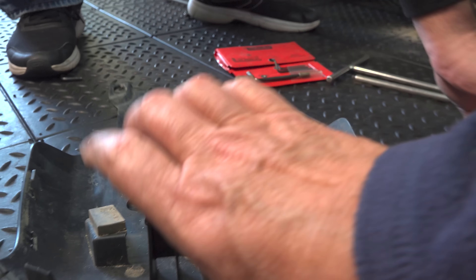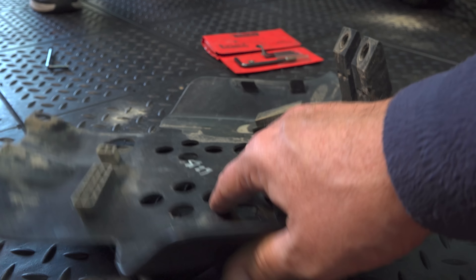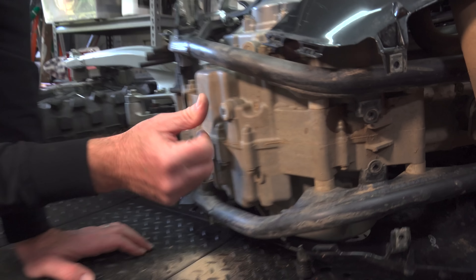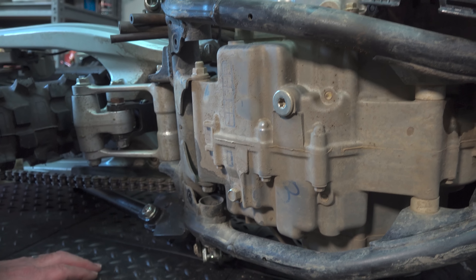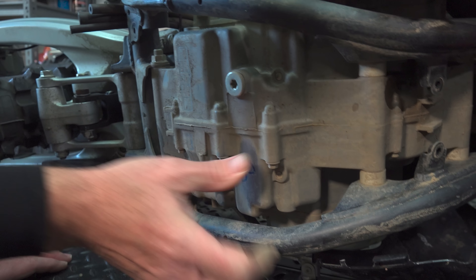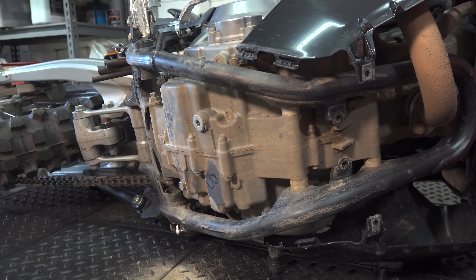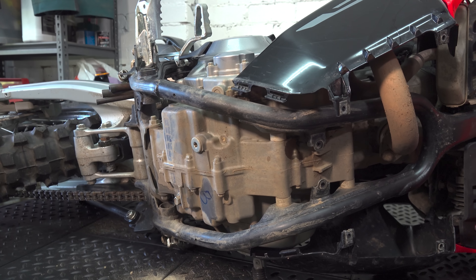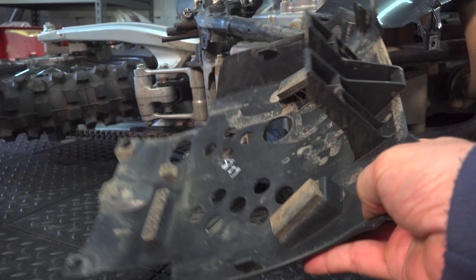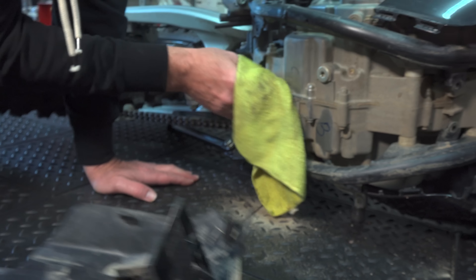That is what's between you and all those Flinders Ranges rock farms. This is a problem for us in Australian conditions — in many countries you've got the ground clearance and that'd be fine, but there's a lot of vulnerability here. You crack that crankcase and you're done. Honda have designed a little nub to prevent the drain bolt from being proud — there's a bit of protection there, but you could still be unlucky. It's a decent-sized tube frame, built like a Sherman tank for a little 300. The bash plate weighs two kilos compared to maybe 200 grams for the stock plastic — so we're adding about 1.8 kilograms. Worth doing.